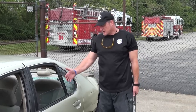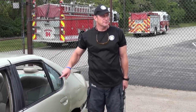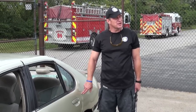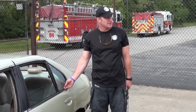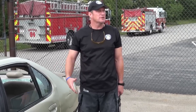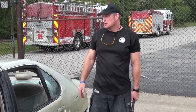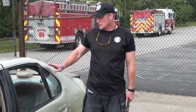Especially on newer cars, this is the point of greatest resistance within the assembly. If I start attacking from the edge right here, I'm basically pushing against the outside of this panel against the point of greatest resistance on the inside of the panel. My likelihood of skinning this out, peeling it, or shearing it without getting a good pop is really, really high. You're a lot better off focusing on the window rails.